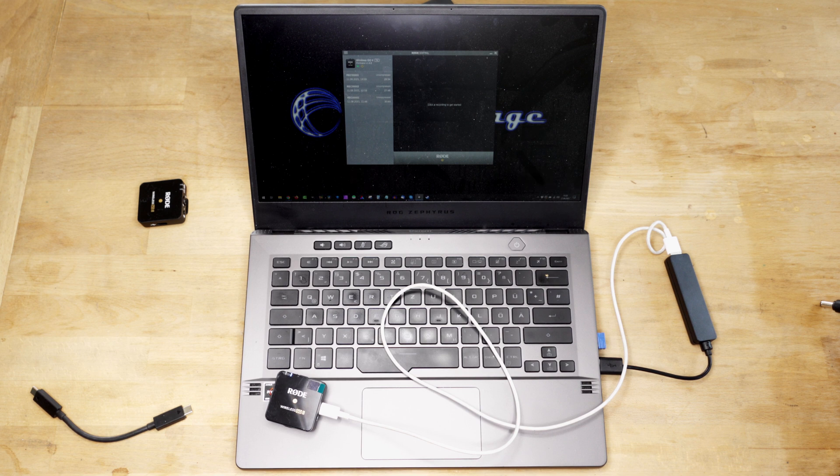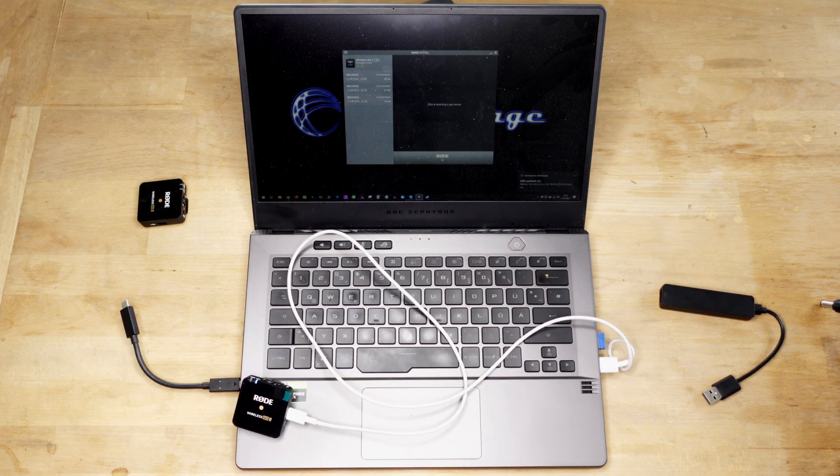The funny thing is, I tried the cable from an old Huawei mobile phone — USB-C to USB-A — and that one works. If I tried a newer USB-C to USB-A cable that came with my mobile phone, it doesn't work. So there is some glitch that has to do with the USB-A type — 2.0 or 3.0 — which leads to the issues. My workaround is to use this dongle, and so far every single USB-C to USB-A cable attached via this dongle worked.